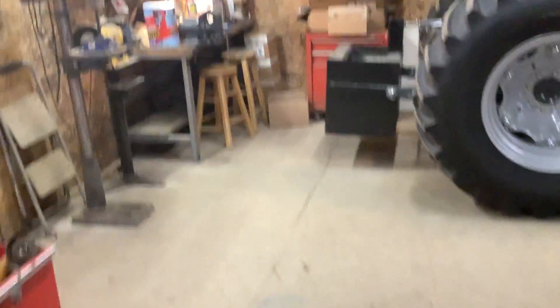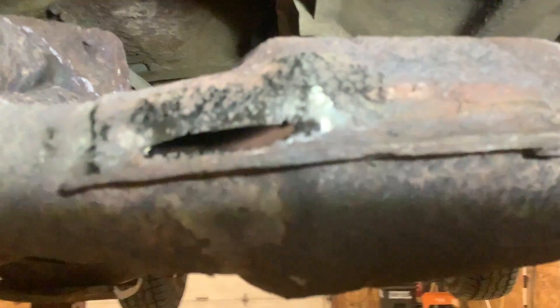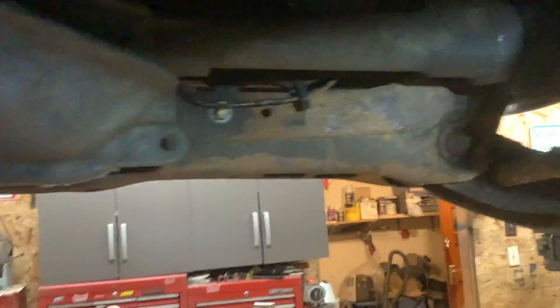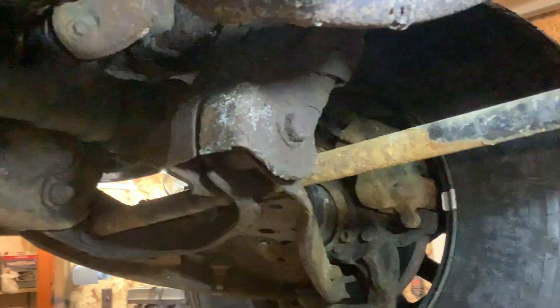All right, up as far as we can go without going through the ceiling. There we are. I'm going to use a little piece of probably 16-gauge to fix that. I popped off the converter and it looks like somebody's already boogered these once or twice — this one's loose, gotta drive the clamps down. These actually self-clamp.